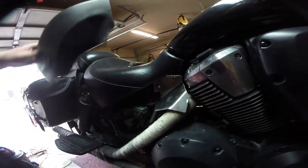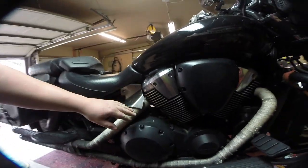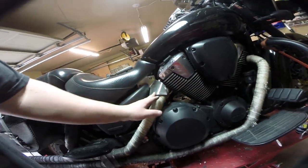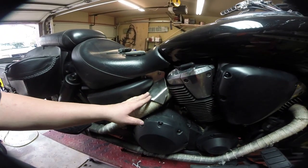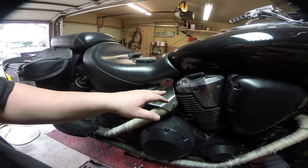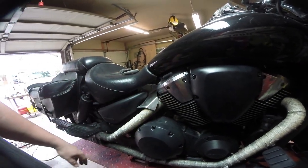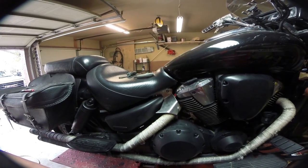So I've put a couple of riv-nuts in the frame and that's what we're going to mount to. We're going to test-fit everything and probably do a little final grinding, but it really looks pretty good. This is one of those things where if you take your time and do it right, you can get a very aesthetically pleasing result without really having any special tools or special skills — just a little bit of time and elbow grease. That's our heat shield in place. Obviously when I went to put this cover back it isn't going to work as-is, so we'll have to make some more trims. But I think it looks really good, it's not going to catch on your leg, and it's really going to shield a lot of the heat from this exhaust header coming to my leg and redirect it back towards the engine. Got a little custom heat shield in here to help protect my leg from getting burnt up. The cover can come on and off smoothly without scratching the paint, with plenty of gap space — stuff like this is what really separates a factory bike from something that somebody's loved. This little tiny heat shield after I paint it black, nobody is ever going to notice it, but I know it's there and I like the way it looks, and I formed it myself by hand and there's just a certain value to that that really brings the bike to life for me, especially something you ride day in day out.